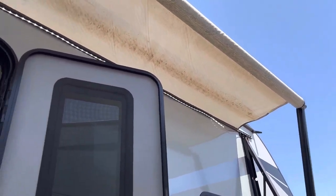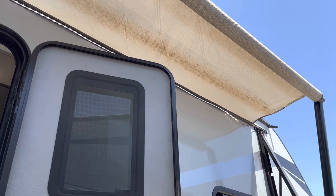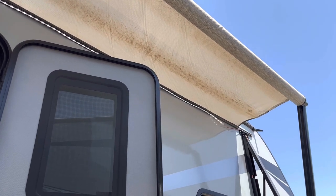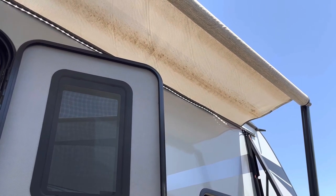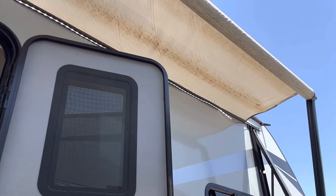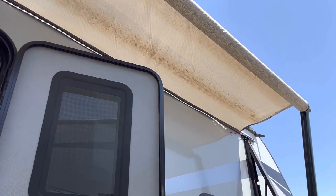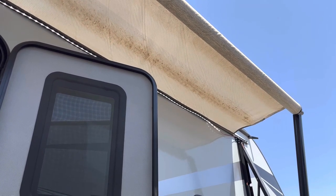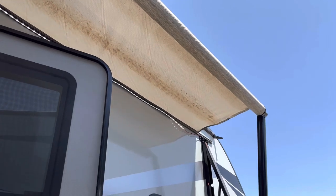Your toy hauler is equipped with an awning, and it's a use-at-your-own-risk type of deal. We ask that you don't ruin it or get it torn. If you're going to use the awning, make sure you put it in at night when you go to bed, put it in if it's raining or windy, and put it in before you go down the road. We've had someone rent this unit, go hunting, come back in the morning, and find their awning completely removed from the trailer because they left it out. Also, when you roll it in, make sure it rolls up with the top going out over the edge so everything falls off of the awning as it comes in.